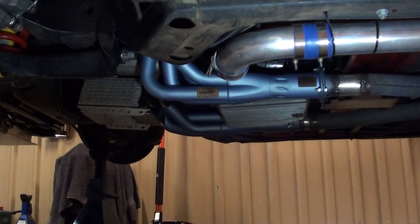From that point when your turbo starts to ramp, header wrapping retains the hot exhaust gas, which excites the turbo a little bit earlier. That makes it more linear when it comes on, giving you a really nice transition period, keeping the temperature going to the turbo so the gas is more expanded. When you run a naked system like you see here with no header wrap, you get the same full boost at the same revs, but it ramps a lot harder - you don't get that nice linear spooling.